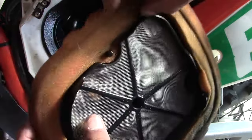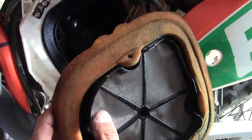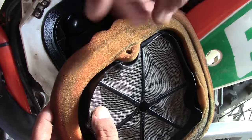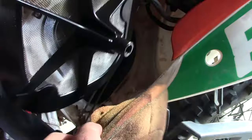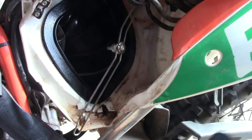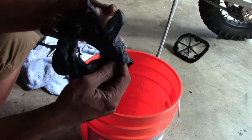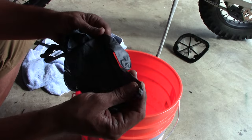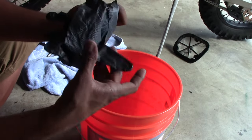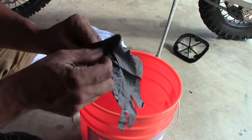All you're going to do is carefully just pull the foam right off of those notches. Now, your filters — if you haven't done this before or don't know anything about filters — they're oiled, right? That's to help trap the dirt. So they're kind of greasy. You can put some gloves on if you want to. I have these latex Gorilla gloves that I'm going to be using. I got them at Walmart, and they've actually got grip on them, which helps with the cleaning part.